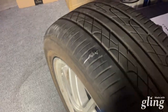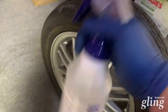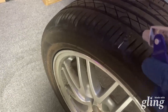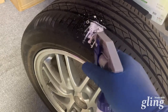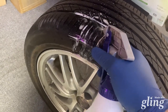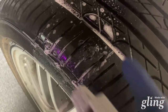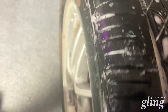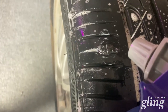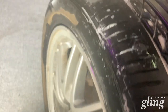Let's see if there's any little air bubbles leaking out right there. I went ahead and made myself a little soapy water spray bottle, so we're going to check to see if there's any bubbles coming out of here. Spray it liberally over the area generously, get her nice and soaking. Any bubbles coming out of there? Doesn't look like it — there's no bubblage. We're seeing no bubbles come up. Great sign. That means we have probably successfully sealed this. Ready to go. I'll have the tools I used in the description.